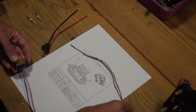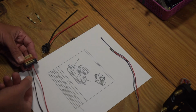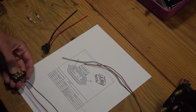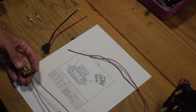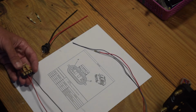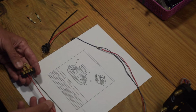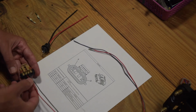The 2 middle ones, you can wire it basically one wire, so you can go straight to where I have this black wire here, that's pin B, and you can go with a resisted wire. Holley sells one for 20 bucks. You can buy this whole thing, and it basically just has an inline resistor, like 570 ohms, something like that, and that makes sure that the alternator is getting good signal and that it knows when to charge so you don't overcharge. You can also run a switched 12 volt just straight from your ignition switch to pin C, which is what I'm going to be doing.